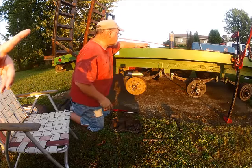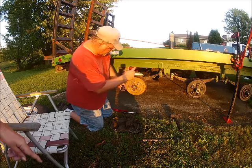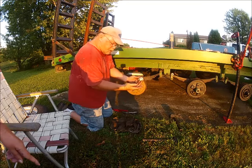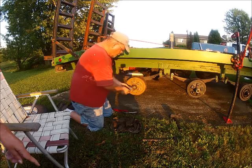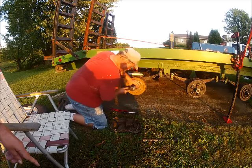And then the dust cap. You can see lots of grease inside that dust cap — as the wheel spins around, it pushes the grease out, and it rotates back into the center, then pushes out again by centrifugal force. That's what keeps the bearings lubricated.